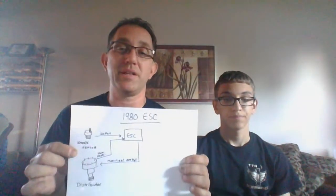As far as that goes, there are people out there who say, well, just replace the distributor. Get rid of that ESC box, because it's not common. Look at us, we've got a 1980 distributor right here. Okay, what's going on in the '80 distributor? We have weights and springs because we're mechanical on this deal. The weights and springs turn with centrifugal force. The faster this spins, the weights come out and we advance timing.